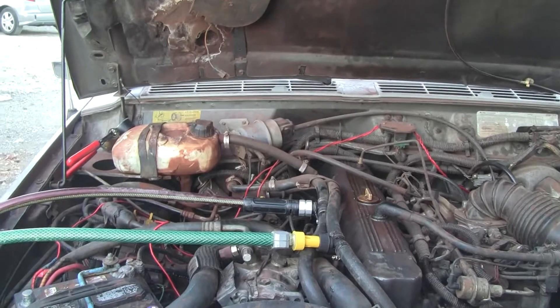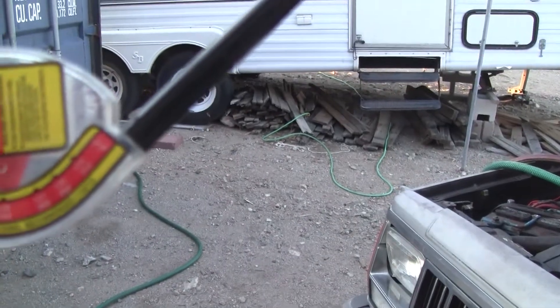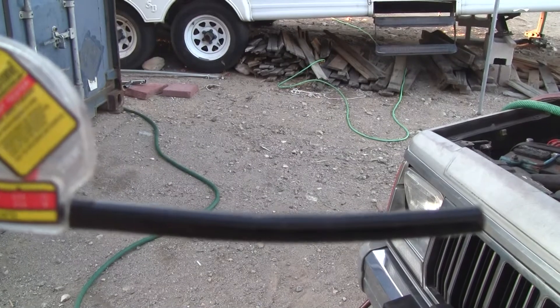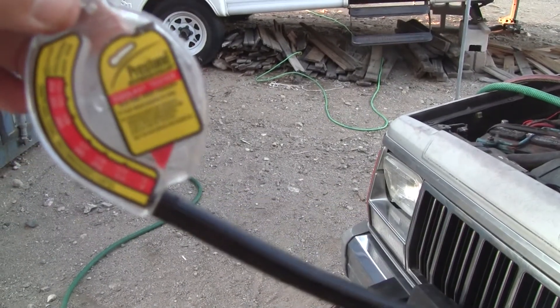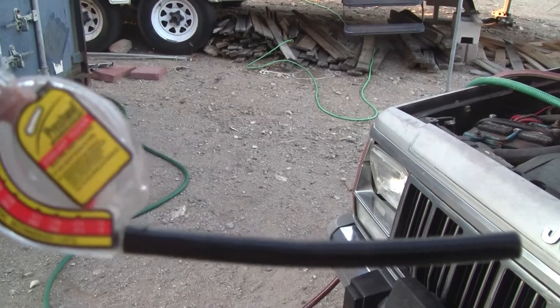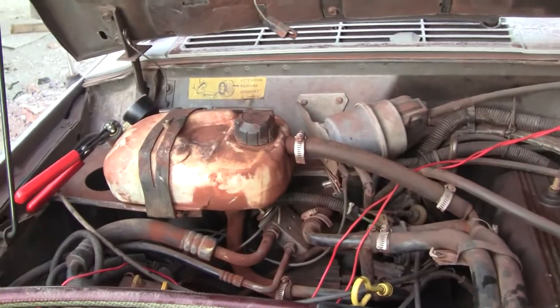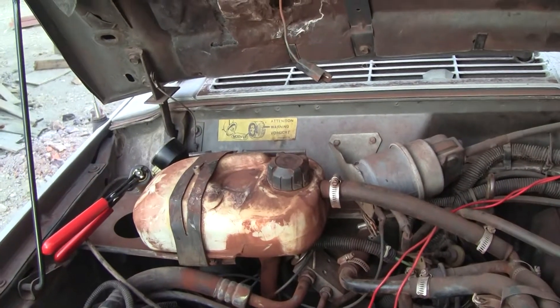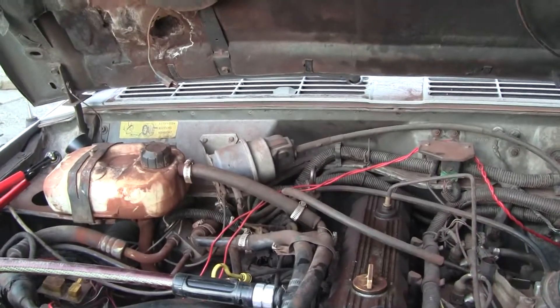255 beats the hell out of 208 every day of the week. I've learned in this system you really need to stay on top of the antifreeze-to-water ratio. Get yourself one of these — they make them. The needle rises up and tells you where you're at. I was at 255 down here but water registered way lower. So I gained about 45 degrees worth of range, and that helps a lot. With only water, once it starts boiling I can't stop it, and that cap will gush fluid and literally pop off in your face.